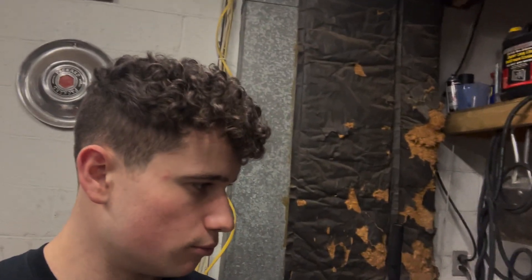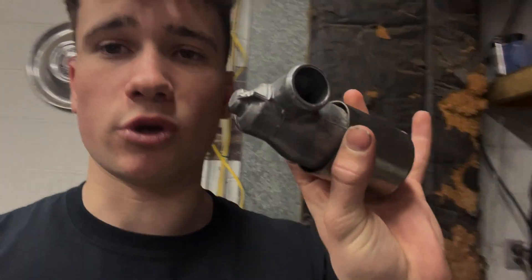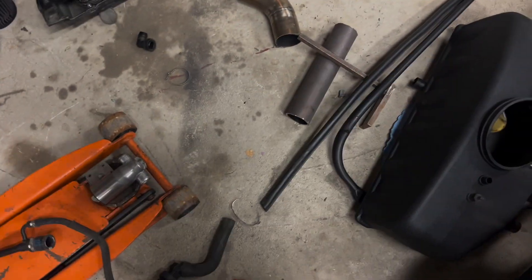You guys can see this one is a lot bigger than the E36 ones because it acts as an idle and low-speed throttle body. This engine has ITBs, and if it just used those, the throttle would be insanely touchy. When the idle air control valve sticks as the car transitions back from throttle, the idle drops, bogs, and it sounds like the car is about to blow up — it's just PCV oil making the valve stick. You throw a little brake cleaner in there, shake it around, and it's good.